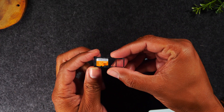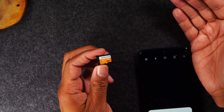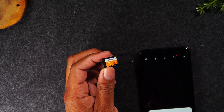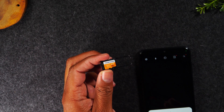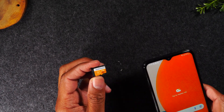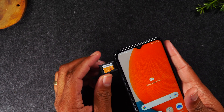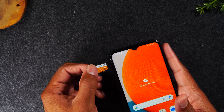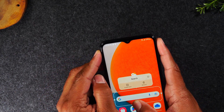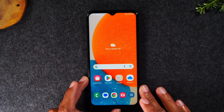You'll notice I'm using a Samsung memory card. Make sure you're using a quality memory card for your phone, because if you use cheap off-brand memory cards you can mess up your phone or lose your data quickly. I only trust Samsung, SanDisk, and PNY memory cards. You'll find a link for a list of some great memory cards at good prices. We're going to take this tray and just insert it right back in, lightly pressing down on the edge of the memory card to make sure it slides in. You shouldn't have to force it — it should just go right in. If it doesn't, you might have the memory card facing the wrong way.